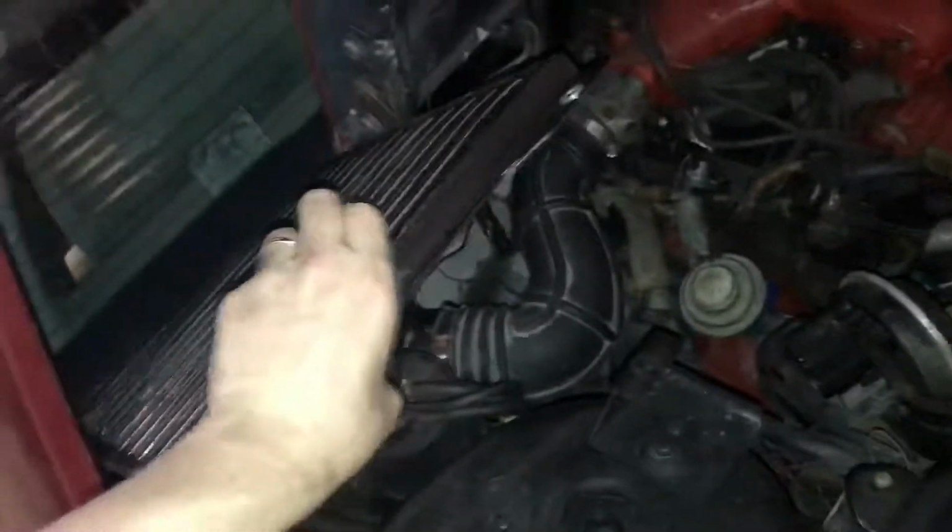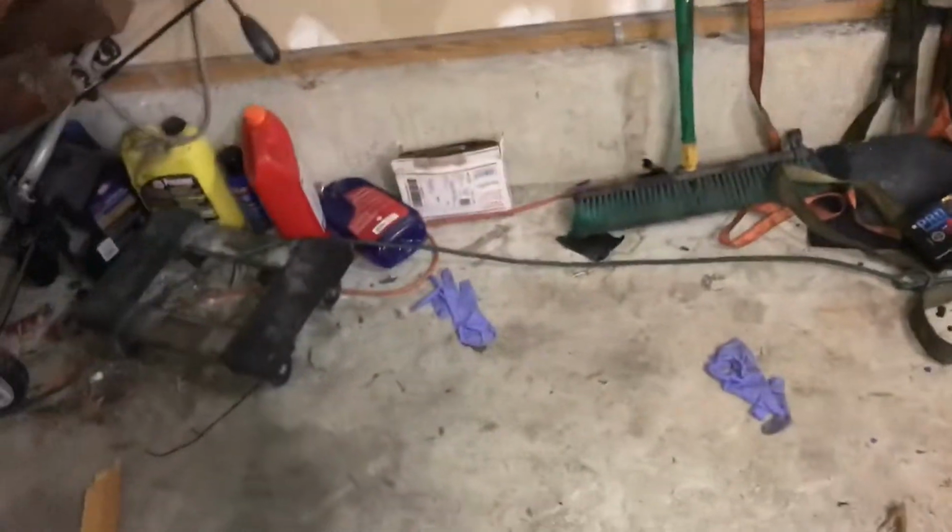When it comes to what went on back here, we'll get into this a little bit. It's kind of hard to see, but we got the bar down there, and what we ended up doing is we did some trial and error with some round stock, if I can find it, which I can't, I'm unorganized. So basically what it came down to is the bar wasn't quite the right length. It was short by about that much, the one that came with the car, because the master cylinder has a different throw out area. So we bought a bolt, played around with it, adjusted it back and forth just to try and get it working as best as it could. And then once we got that kind of dialed in, we cut the bar stock a little longer.